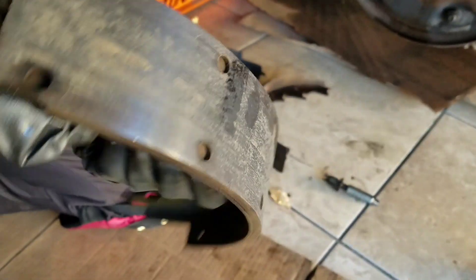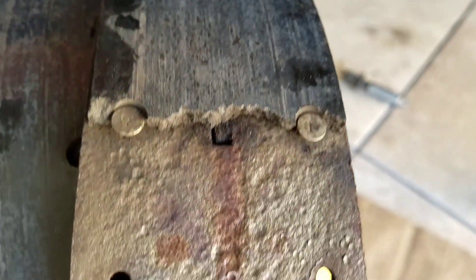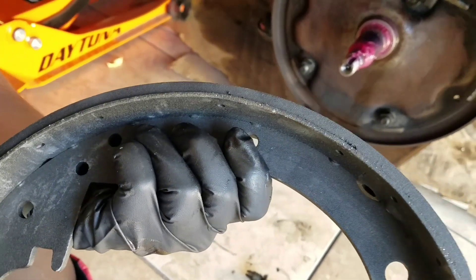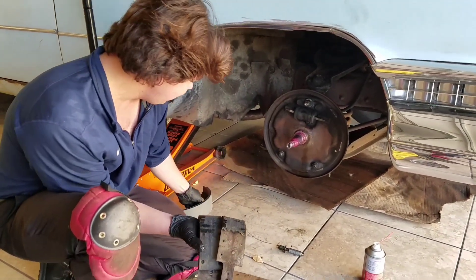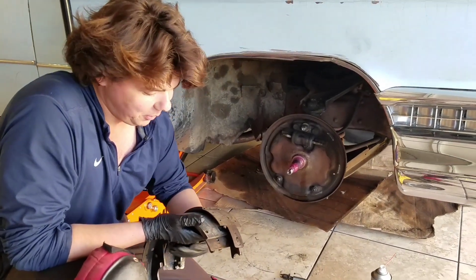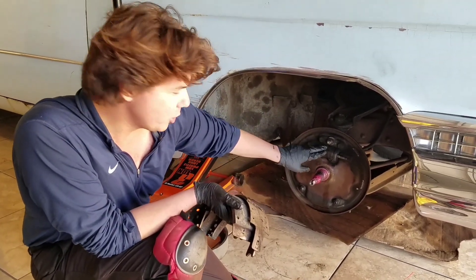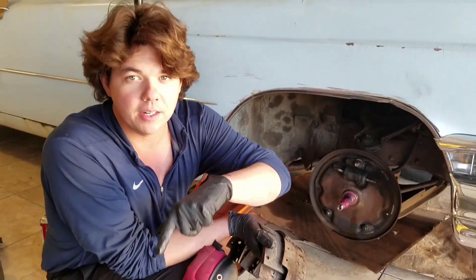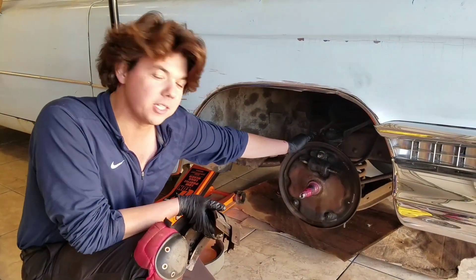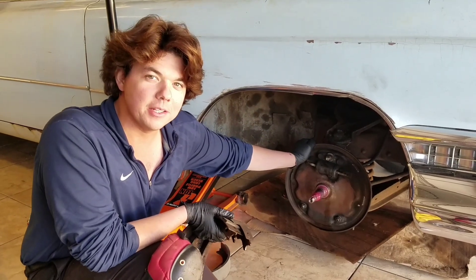But this back one actually broke, and it actually overheated. These are the old riveted type. The new type of pads are actually bonded on, and it's a matter of what people like better. My feeling is the bonded type will probably hold heat better and probably won't crack as easy, but I just really don't know. It'll be neat to see what it feels like and to have even braking — there's a little bit of pulling since the pads are messed up. I'm assuming all the fluid has been overheated inside here because this broke, and there's some scarring inside that actual drum with a little bit of ridges. Because of that overheating, especially on an old system with old brake fluid which isn't synthetic like what we're going to put in — which we already have in there — I'm sure it's going to be a whole lot better.